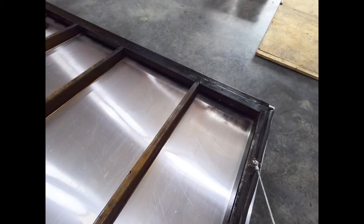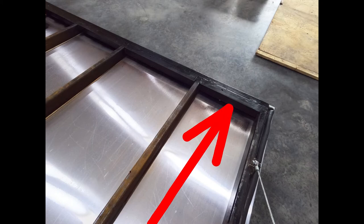I didn't ever think I'd have to make this video, so I need to get you up to speed with the work I've already completed. We need to get down to the framework of the door, so you're going to remove any of the trim, the diamond plate, the plywood, etc. The framework of the door is built with one inch by two inch square tubing. With the tubing standing up the way it is, we just have the one inch face to work with. Since we want to drop our ramp track down to reduce that speed bump, we're going to need to widen up that aft end of the door. So I added a piece of one and a half by one and a half angle to make that very aft part of the door two and a half inches wide instead of one inch.